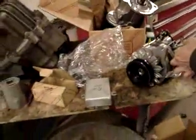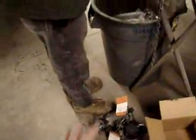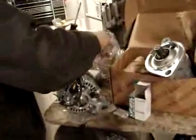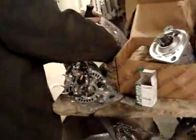These are brand new factory components, which is really a good way to go. Here are our older ones that could not be converted. We'll be using the vacuum pump off the back side of that stock alternator. These units will bolt right in, so this is going to solve a lot of issues and allows us to move forward with getting this thing started and hopefully getting it down the road very shortly.